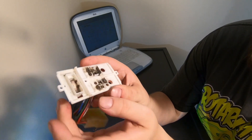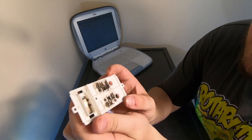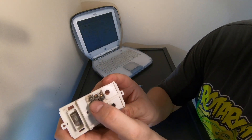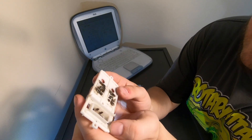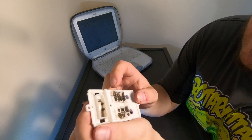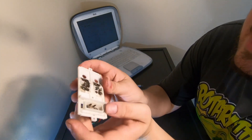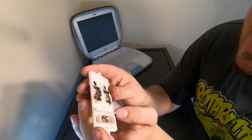These contact pads as well as the rocker contacts are covered in a copper coating. If you rub that off, the base metals they're made out of will actually corrode even faster. That's why you use a pencil eraser to get all this black corrosion off. Now over time, if you are cleaning these switches often and you don't use dielectric grease, you will rub that copper off. So let's go ahead and grab a pencil eraser and start cleaning these up.